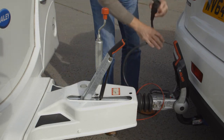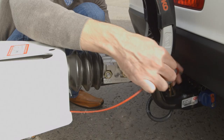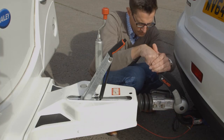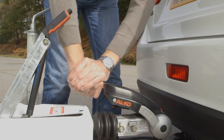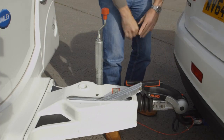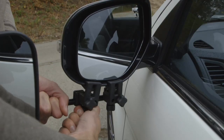Connect the electrics and attach the breakaway cable. Clip it through the steel ring welded to the tow bar if there is one. Make sure the car's handbrake is on and then let the caravan's handbrake off fully. Fit towing mirrors to your Mitsubishi so you have a clear view of the road on either side of the caravan.